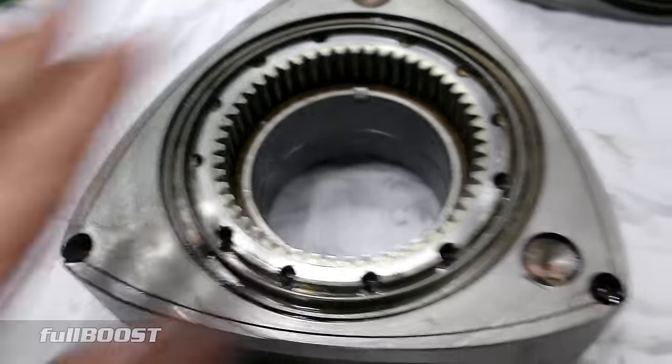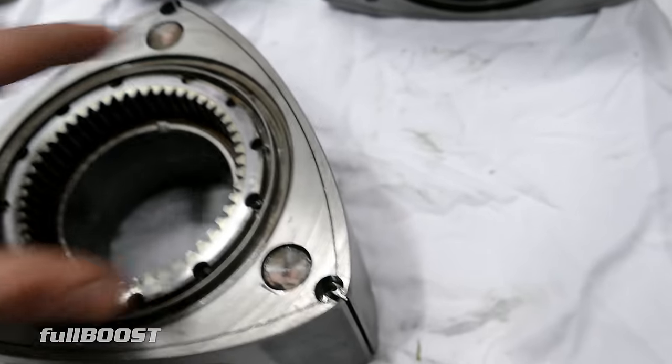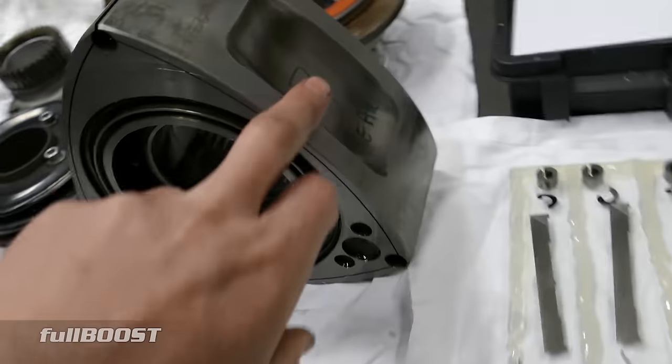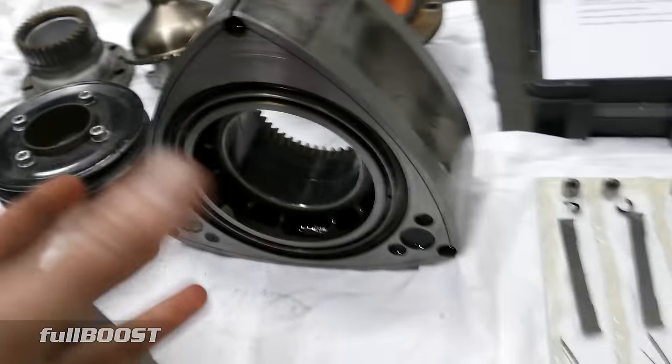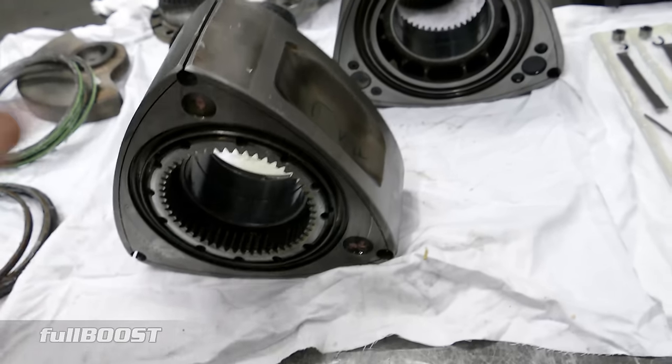White goes to the front — not the gear side. This is the front rotor, so this makes it the front of the rotor. This is the rear rotor — this is the front of the rear rotor. The engine's rotating this way, so it's very important that these springs are installed on the correct side. If not, the spring won't be able to seat in the little groove.